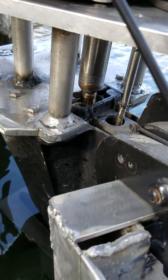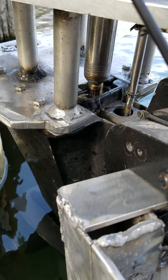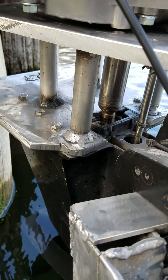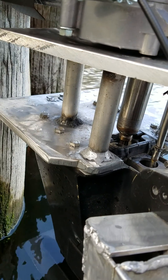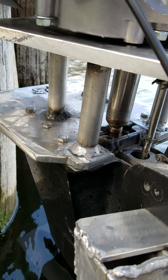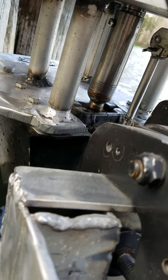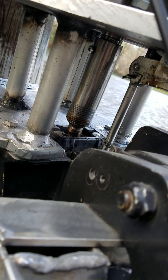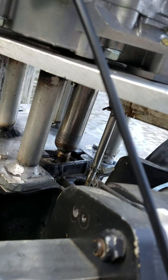It was a 3.25 OD thick wall pipe, a piece of stainless. Then I took another piece of 7/8 inch thin wall pipe for the main shaft, welded both of those inside a 1 inch ID sleeve right there, and centered everything up. That did really, really well. I've had it out here all day running through weeds and mud and everything.